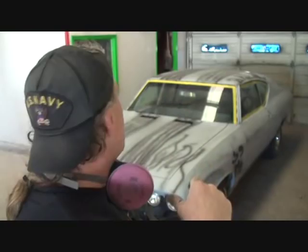And the only thing we're doing this for is to bust off that top coat, that real hard film that creates itself. I'm sure everybody out there that's ever sanded a car or something in primer is going to relate and say, I know what you're talking about. It sucks. You waste half your sandpaper trying to get that top layer off because it's hard as a rock. Well, this is the cure right here: a good DA sander, a nice steady hand, and very fast motion like I'm about ready to do right now.